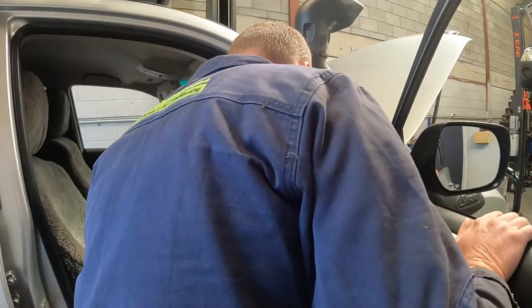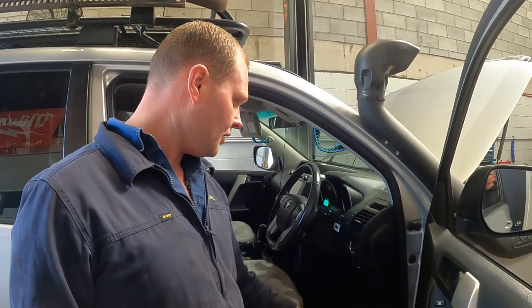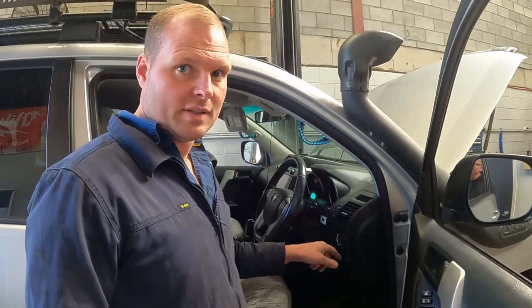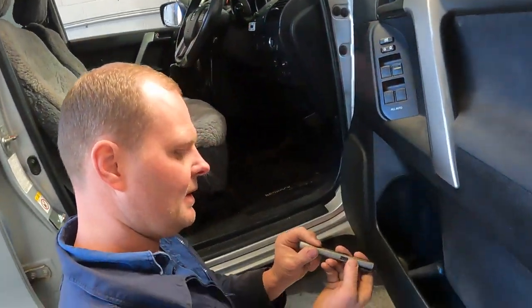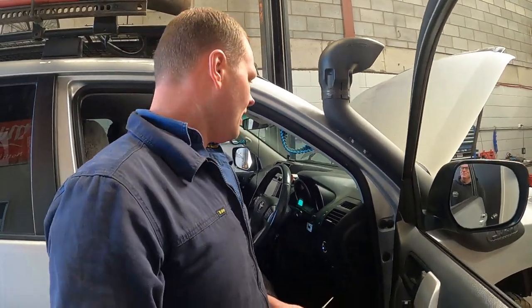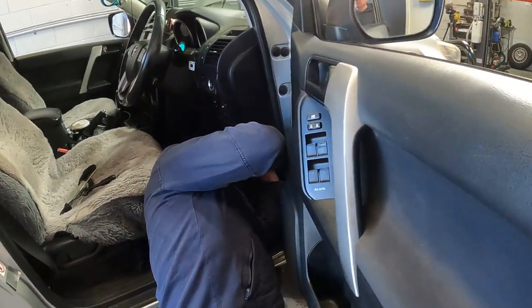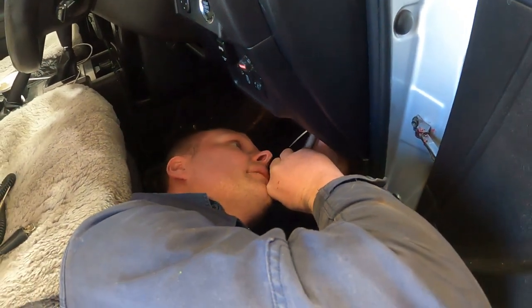So we're checking power now to make sure we don't have any airbags pop out. I'm just going to pull the cover off that fuse panel and check the fuse for the airbag and the ECU, just to make sure there's no power there. We can confirm there's no power to it — definitely no power going to it. You can start working now. We only disconnect the horn because it's annoying having it continuously going off while you're trying to work on the vehicle.